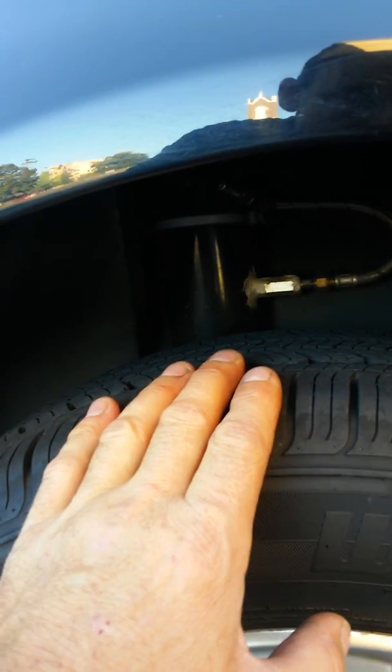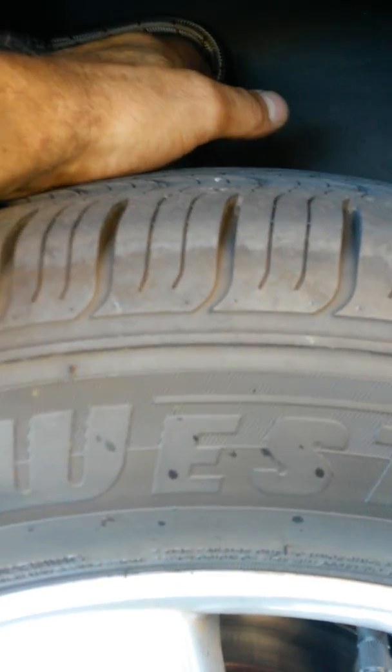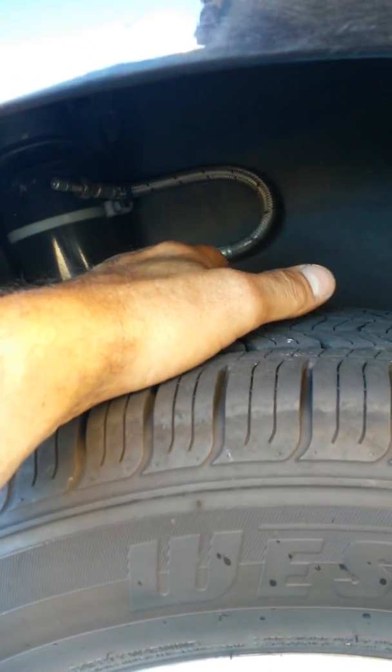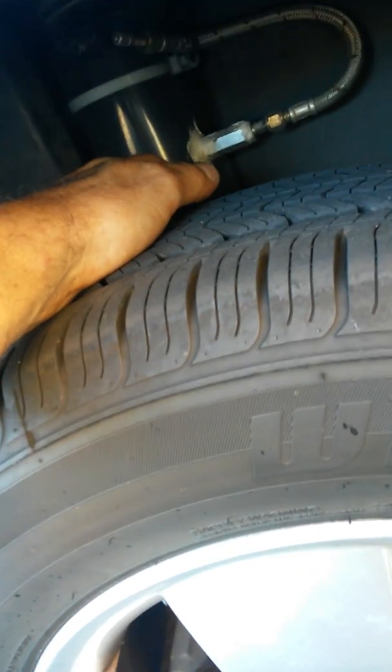What I've done on the rear end — if you take a look in here — I've actually added air shocks for a Cadillac. You can look that up on the forums. I modified this with a semi hose — a braided steel line that goes between semi truck tires. That allows the two tires to be aired up at one time on semis. You get that at Napa. And PC7 is about the toughest epoxy you can use — I've used it on a racing boat.